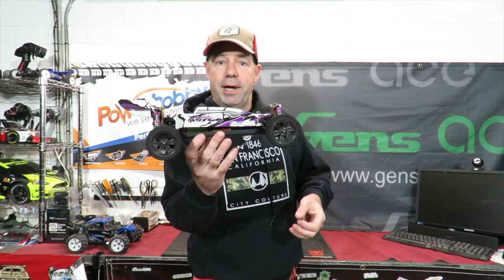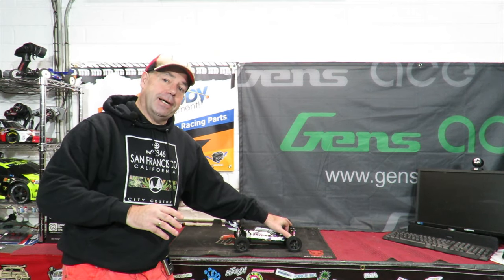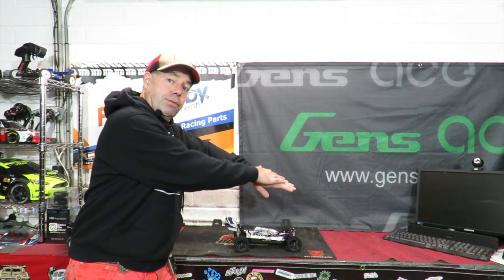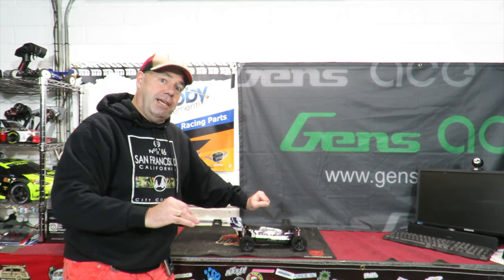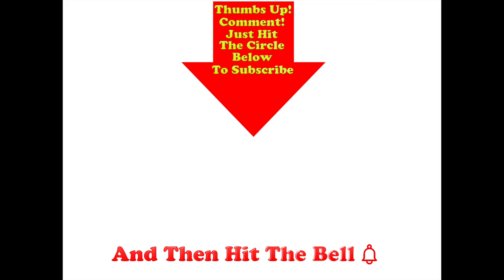The car has no added weight, no extra wings, canards, or anything like that at all. The only modification other than the electrics is at the front where I've put in two droop screws, which has lowered the front of the car down so it runs at an angle — getting the airflow pushing the front of the car down rather than getting underneath it and flipping it up. Although we did have one near miss in that video. Undoubtedly this thing will be going over 100 miles an hour on its next time out. Thumbs up if you liked this video, post any comments below, hit the circle to subscribe, and don't forget to hit the bell.